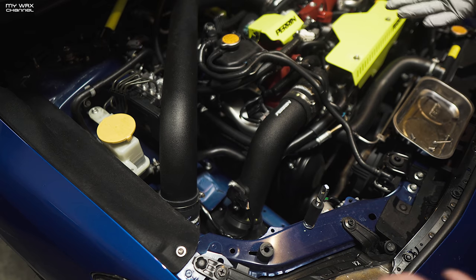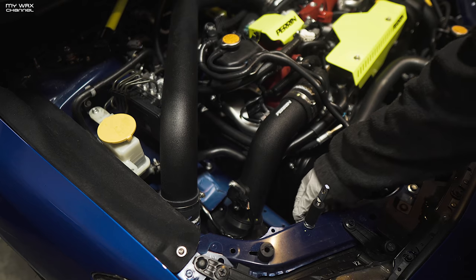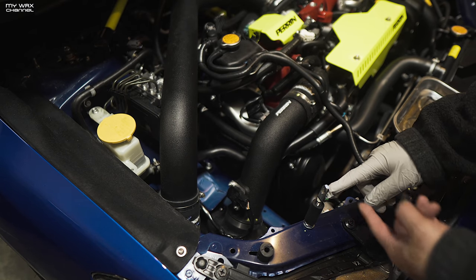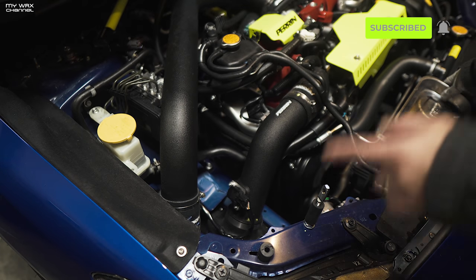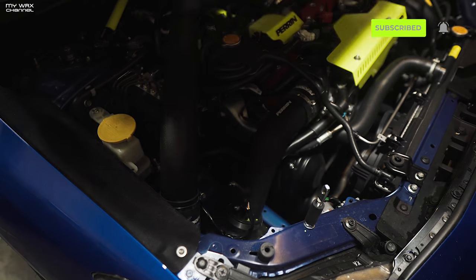Like I said before, this job is never fun. So what I did was attach the hood pin to the radiator support right here, and I dabbed on top just a little bit of metal polish. You can use anything such as grease, something that will transfer over to the hood so that you will know exactly where to drill. Hopefully this transfers over.